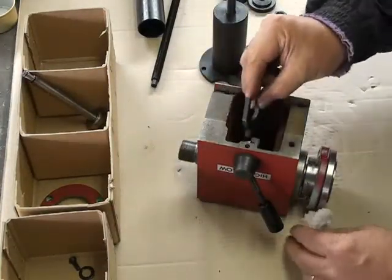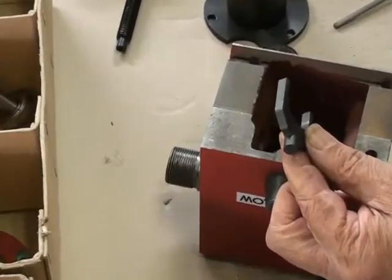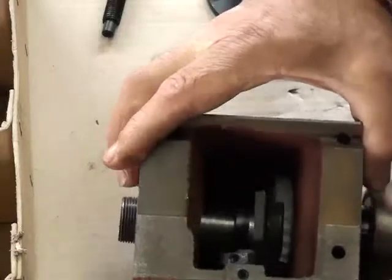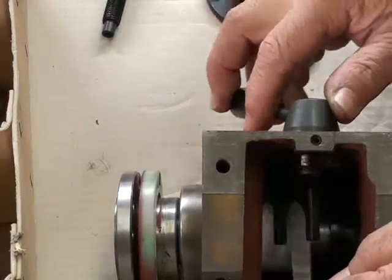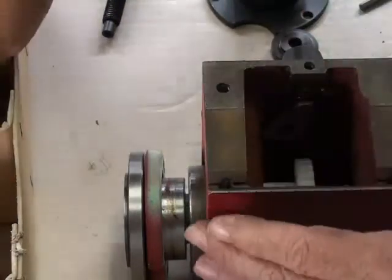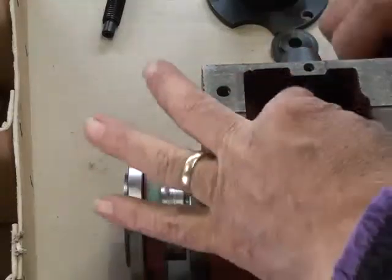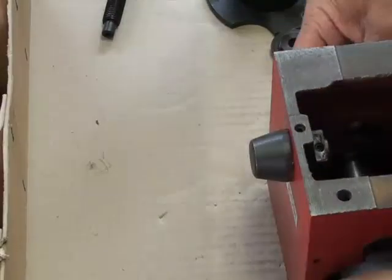And that's it there — that's come out, through a little hole here. I'm looking at the shifter fork. That can go in there with that shaft. And this is the high-low gear that came off the shaft. Some instructions tell you that you can take this little lever off, but unless I have to, I won't — it doesn't look like I need to.